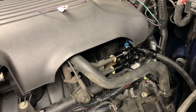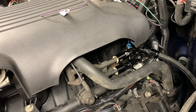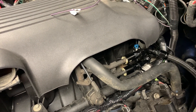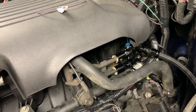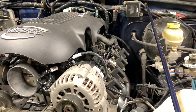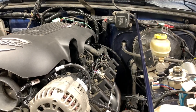At the end of the day I don't know if going with the fancy hose was entirely worth it. The 5/16 return line — I probably could have just used regular fuel line and a couple of those barbed fittings and saved quite a bit of money. However, with the pressure line it's a little different because it's 3/8 going into the motor and your fuel line coming off the back is 5/16, so there's a little bit of a dilemma there. I hope you guys enjoyed the video on doing the fuel system, how I ran the lines. If you've been down this road before, I'm curious to know how you did your fuel lines. I'll talk to you guys in the next video — see ya!